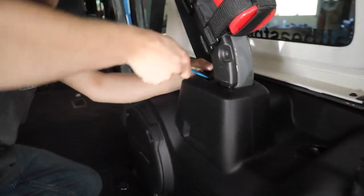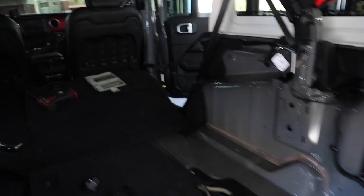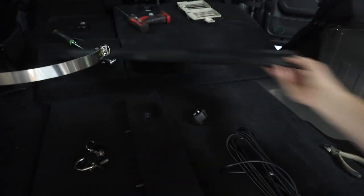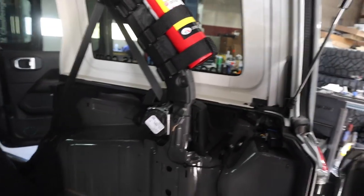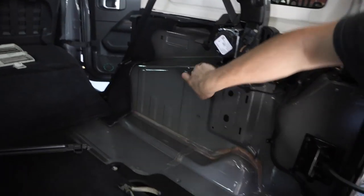We're not going to film taking this all apart — we'll just explain what you have to do. Tracy's got all the trim panels off back here. I took this off with a T-40. You get this out of the way, then pull your bolt tray out. Once you get all that out, there's going to be a clip here — all you do is pull up. You've got to get this plastic piece up and out, or else you're going to break it. Once you get the clip out, you just pull back. But if you've got a subwoofer, make sure you unplug it before you take it all the way out — the subwoofer is actually installed into the trim panel.